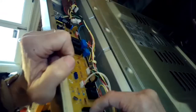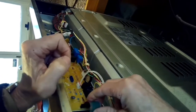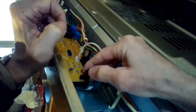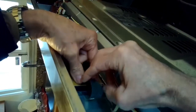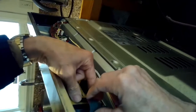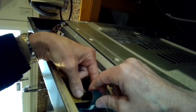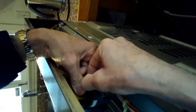You can also use electrical cleaner to do this — it will work. You can get that at Home Depot in a spray can. But the eraser should do the trick. If you put it back together and still have the same problem, it's pretty easy to replace the touchpad. They cost about fifty to sixty dollars. But this is so fast and easy it's worth a try — I would say it works about seventy percent of the time.